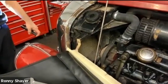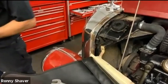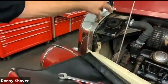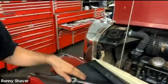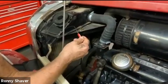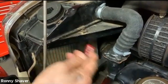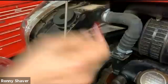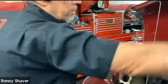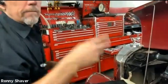This is not really a pressurized system. They started getting serious about pressurizing when they started putting AC on them. You just bring it up to the bottom of that opening — just as long as you're covering the core. Coolant comes up here when it's coming out of the engine, and if you have enough to cover the core it's going to distribute better. If it's below the top of the core, it's just going to go down the center and you're not going to get good cooling.